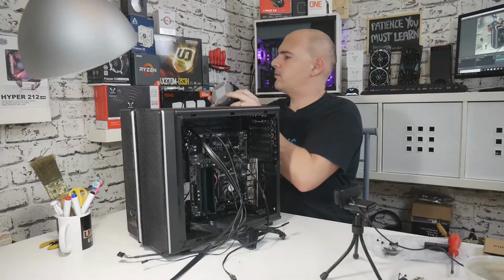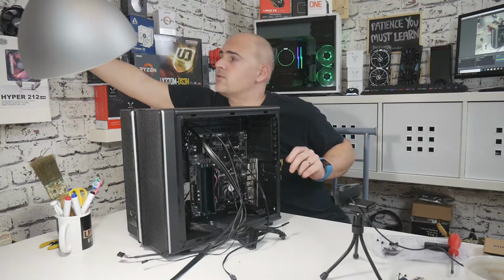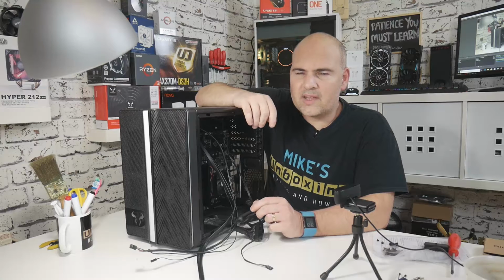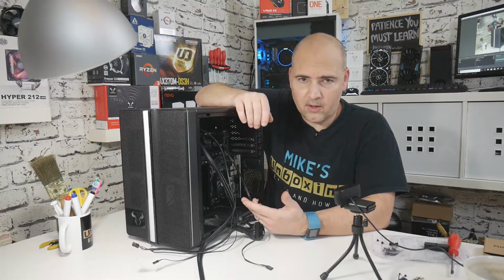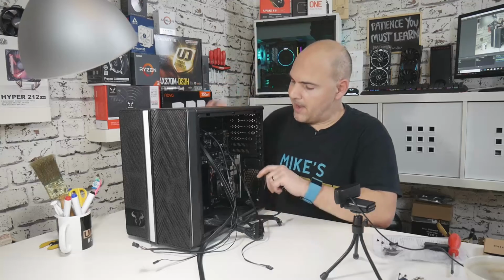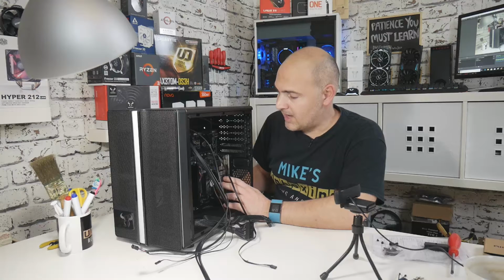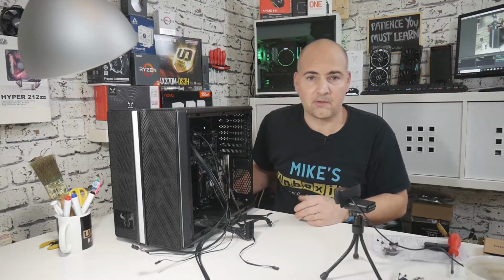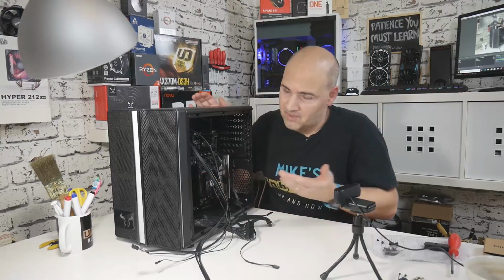I do have another one somewhere, which I am tempted to try to see if there is any difference. But it's one of those things, because the CPU runs so cool, it's almost wasteful to use a better fan on it. And also, you can't overclock it, or, well, you kind of can, but you can't. MSI boards can because of a mess up on their behalf. So really trying to get it any cooler is a bit kind of pointless, because you're not going to get any more benefit out of it. It doesn't generate a lot of heat anyway, and if you are going to replace a cooler, it's going to be 10, 15, 20 pounds worth. So you're better off selling that to put some money back into the system rather than wasting it on a fan, in my opinion. Being that that is included in the box, you might as well use it. But that's just my opinion.